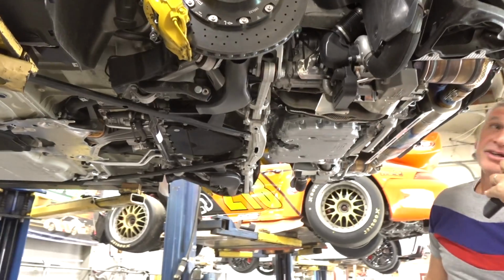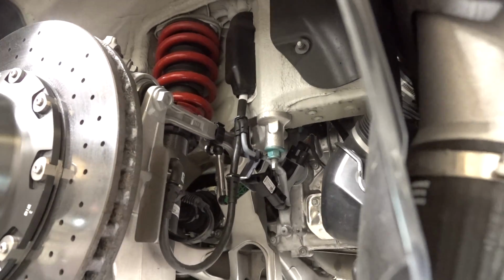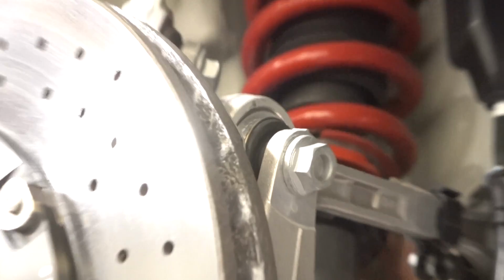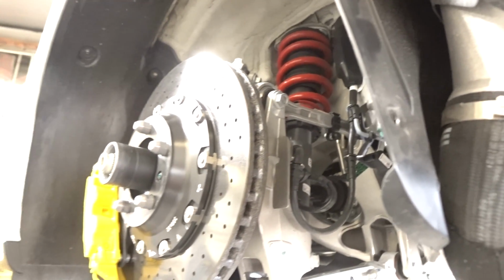The springs. We didn't get to take a look at the springs. We got to see the springs on this side. And the shocks. Now, those are some beefy springs. Those are not your regular 400, 500-pound springs. I have not put them on the spring dyno and run them through, but just to see the diameter of the wire itself and then the length of it, it does have a large diameter, which I like. It really manages the frequency well, because the frequency of the tire is almost perfectly matched to the chassis. The car is amazing the way it puts down power, and the spring rate, I'll bet you, is in the 700-pound area. And the same goes in the front end.